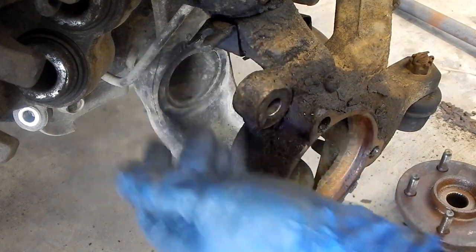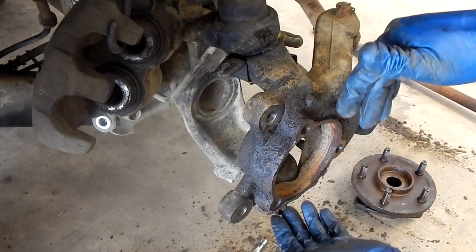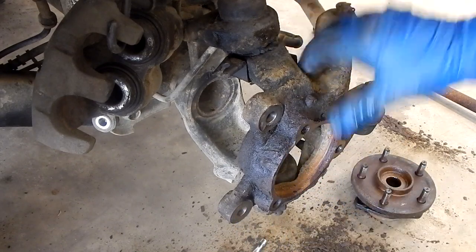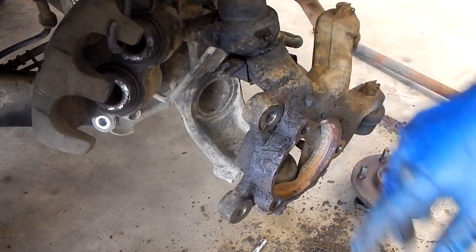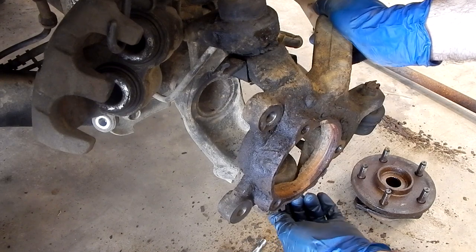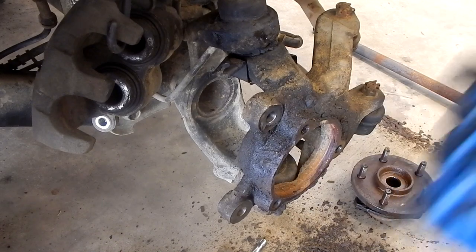Next we're going to take our cotter pins out of both ball joints. We've got one up here with the nut right under here, and it does have this bracket for the ABS sensor. Both ball joint studs are pointing down, so if we were to take all of the nuts off and then break the taper on one of them, it'll actually break the taper on both and you'll drop the knuckle down. I'm not going to remove the tie rods — I plan to go ahead and pop this off, move it over to the side, and use a bungee just to hold it up on the sway bar. Then we can pop these ball joints out with the press, put the new ones in, and put these back on. The key is I don't want this knuckle to fall because I'm going to leave it connected. So after I take the cotter pins out, we'll loosen the castle nuts but leave them on the threads — that way we can break the taper but have control knowing they'll stop when they hit those nuts.